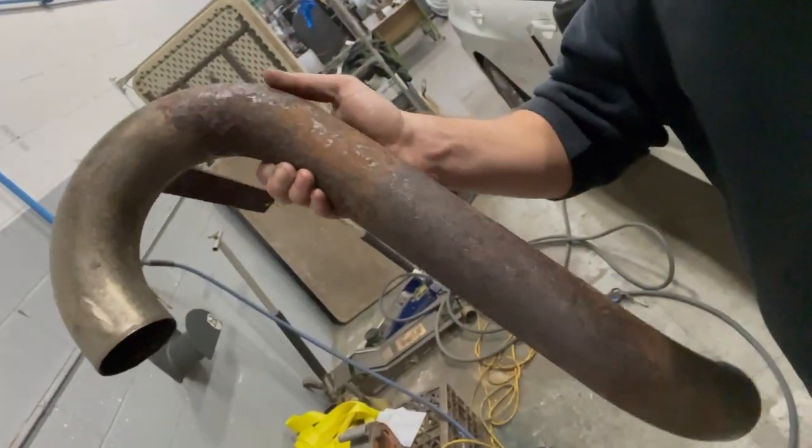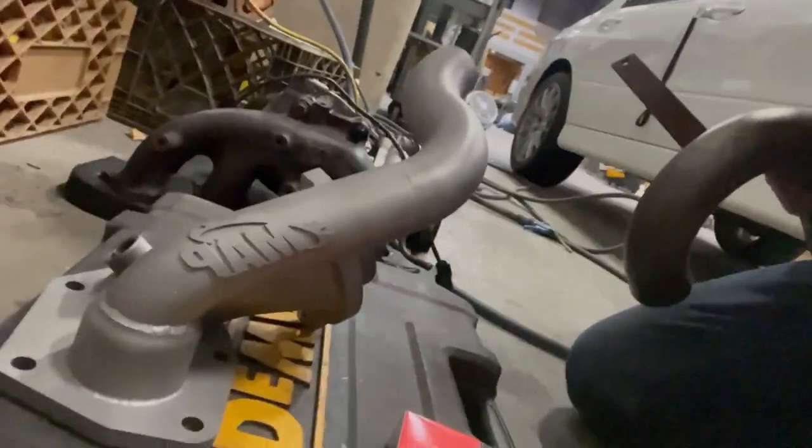Again, all this stuff is gonna be pretty temporary for now. I just wanna get the car together, running right, and safe, and then over the winter, we'll start changing over some stuff. So I'm coating the upper intercooler pipe and the lower on the other side, and we cleaned up the MAP dump tube housing with some glass beads, so it's a nice satin finish on there. I'll just clean it up, and that's pretty much it. So let's get to sandblasting and powder coating some stuff.